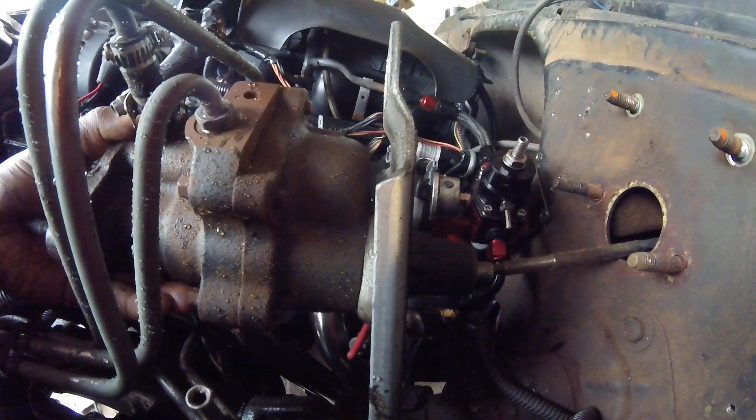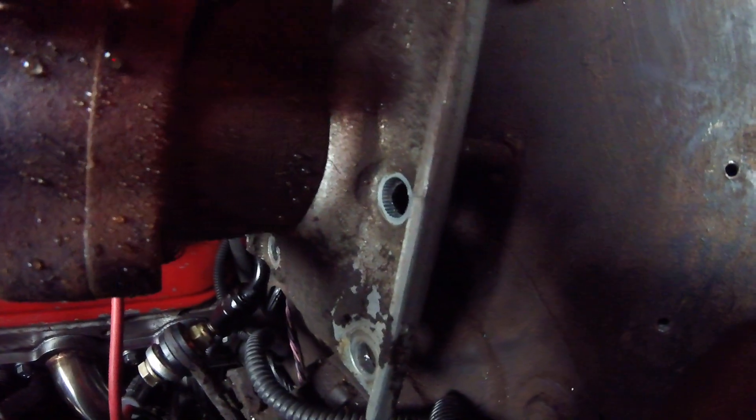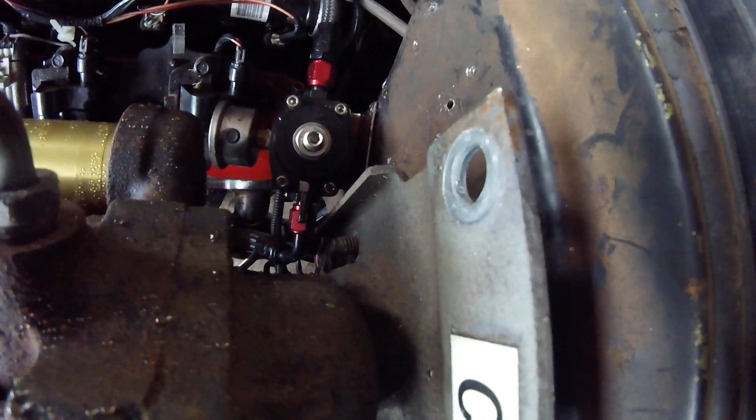And if you ever needed to buy another brake booster, it's an e-clip on the back — easy swap. There were two serrated studs sticking through those holes. You just take a hammer and knock those two bolts out, and it lines right up on both sides. The problem is the top bolt holes don't match up, so you have to drill those out — which I've marked with a paint pen. The bottom holes won't match either, but you'll end up with four holes, just like factory, holding the plate and the brake booster to the firewall. The lower part of the bracket you just trim off — easy.